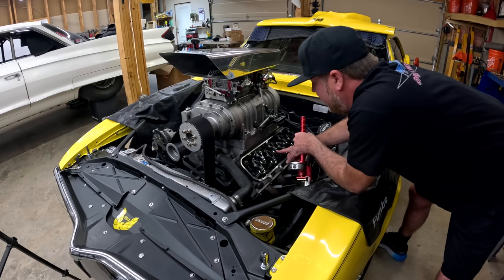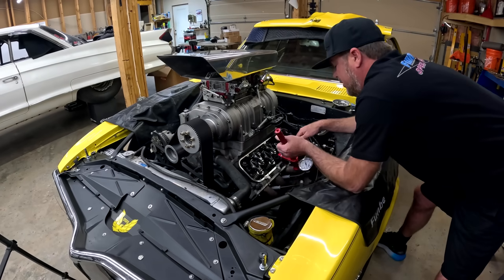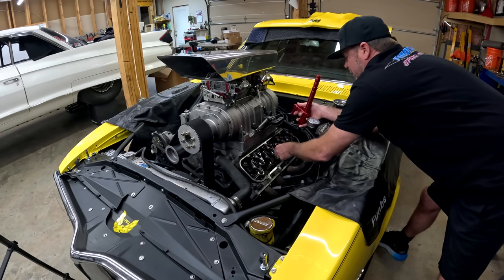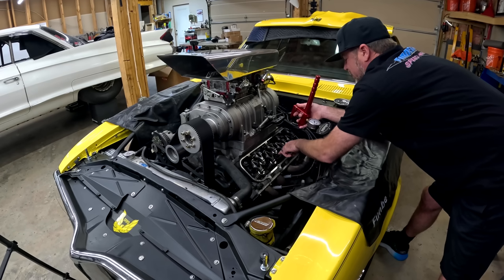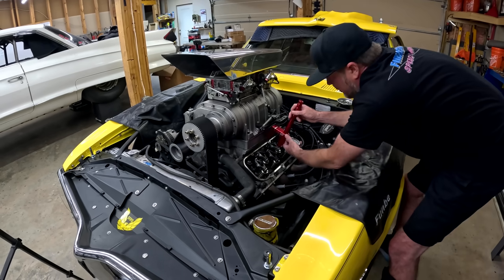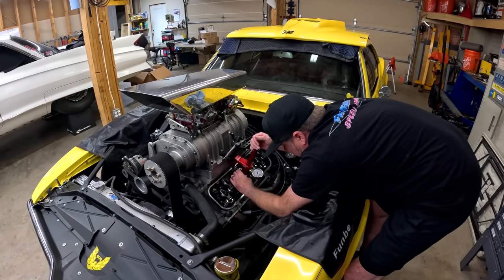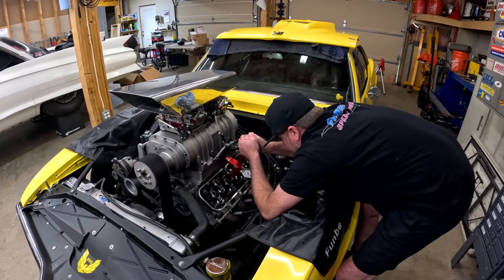So right now you can do two things. You can slide feeler gauges in there and figure out what the lash is. You can also take this LSM on-head spring checker and find out how much pressure it takes to just lift the valve off the seat of the cylinder head. And I have no idea what these are supposed to be. And truth be told, this tool was set up for shaft rockers on another motor, but I'm gonna use it today on these stud mounted rockers.